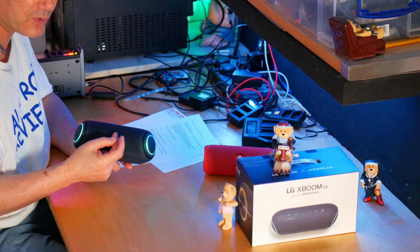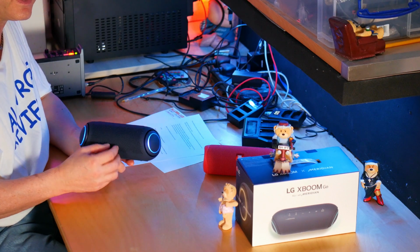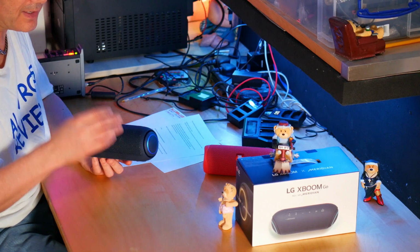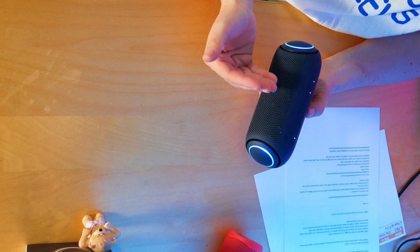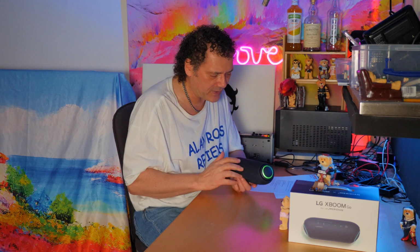The highs, that 14 kilohertz and 3 kilohertz peak for the sound boost, and there's still a big 14 kilohertz peak in standard mode. It's just not as big as in sound boost mode, and together with an already bright tuning, that makes it a very, very harsh listen. So would you rather have the bass of sound boost mode along with the harsh highs, or the more even but bit dull and bass light tuning of the standard mode? We'll leave that for you to consider.